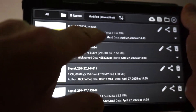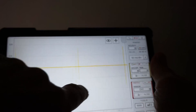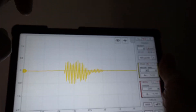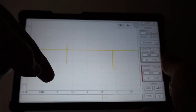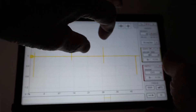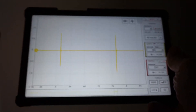Here are the four waveforms we just captured. Opening one up - these parking sensors go in bursts about 200 milliseconds apart, roughly five per second. Zooming in on one, that's what they look like. I did these captures one at a time - record, save, and so on - mainly to show what the waveforms look like. Normally we don't do it that way; we just go quick and dirty in scope mode, looking for a signal, and quickly move on to the next sensor.